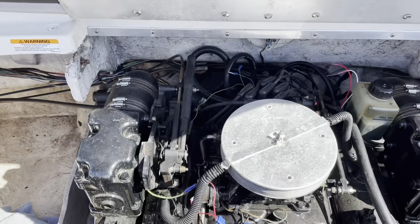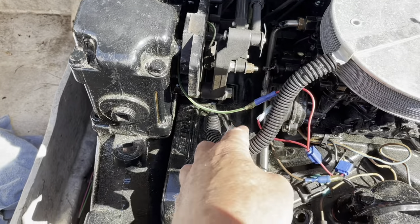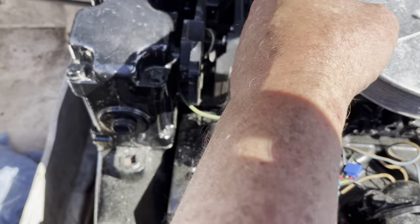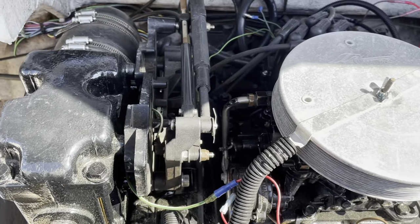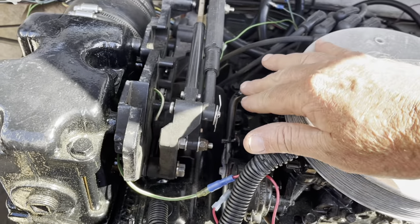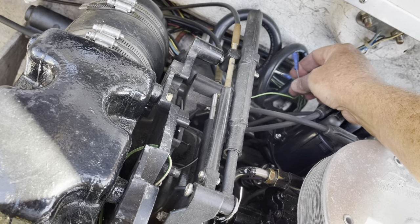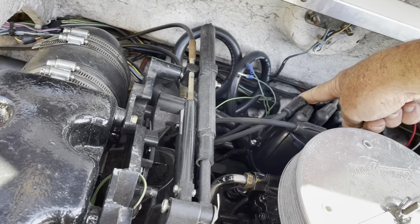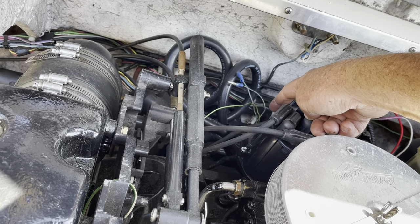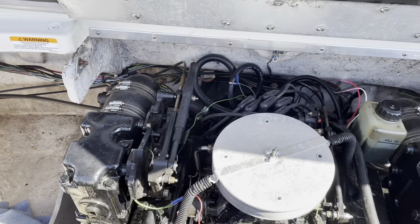To wrap up this EST upgrade, I've got the power coming off the choke feed tapped here, going to the shift kill switch, and the other side of the shift kill switch goes to the distributor. If you want to set timing, all you have to do is disconnect the shift kill, hook the two wires together to bypass the shift kill, and you'll be in set timing mode by connecting those two together. If you buy a full EST kit you'll get two of these set timing connectors — one for set timing, one for shift kill — but then you've got a tool you don't use and will probably lose. I like this way better. That's it — thanks for watching, subscribe if you get a chance.